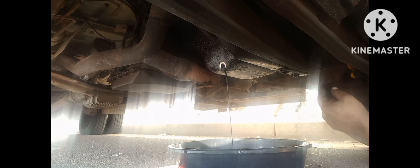Engine oil should not be black like that. We ran into one problem doing the oil change on the RV — there's an oil filter adapter that attaches to the motor, and the oil filter adapter was loose. So while I was trying to take the oil filter off, it wouldn't come off, it wouldn't budge. I stabbed a screwdriver through the oil filter and tried to reef it off — still wouldn't come off. Ended up taking the oil filter and the adapter down to an auto mechanic place off of 19th Avenue and Indian School. Big shout out to 19th Avenue Garage — thank you very much for giving us some assistance with that.